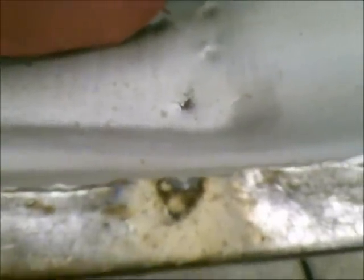I've also got the inside edges welded and ground down a couple of places on the fender lip. I've still got to grind that one. There was a little spot right there that had some rust in it, so I ground it out and basically filled it back up with weld. I've still got a couple of small holes I need to fill in with weld, but I'm going real slow so I'll make sure I don't warp anything.